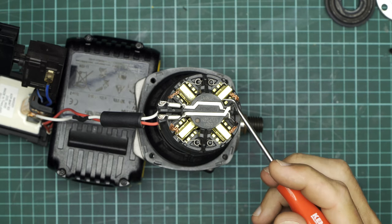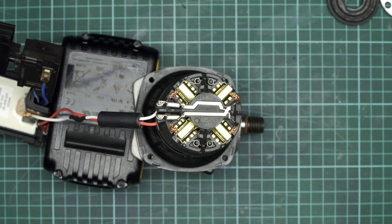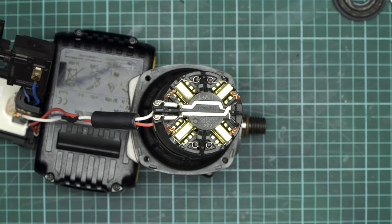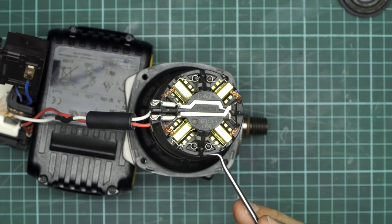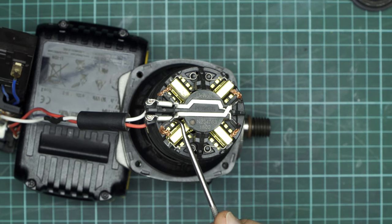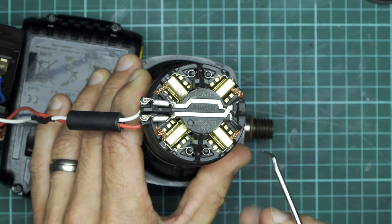Checking out the tail end of the motor, we can see it's got the DeWalt branding on it and the material marking PPA-GF30 — polyphthalamide, glass-fibre reinforced 30%. I believe polyphthalamide has a good combination of strength, ductility, impact resistance, and good thermal performance — which is quite important for a brush block at the back of a motor, because this thing gets really, really hot. The motor's leads — there are two of them — are connected to the brush block by two flat spade connectors, which are quite easily removable. So the brushes are a serviceable unit, which is quite a nice feature.